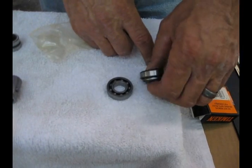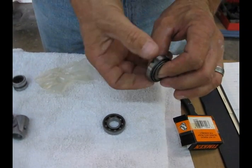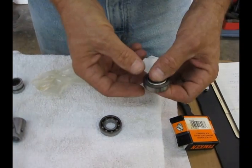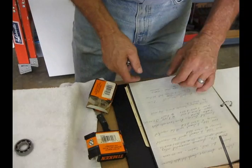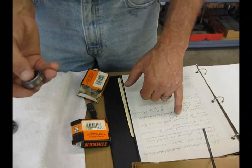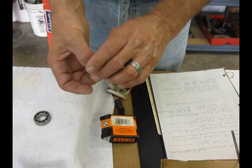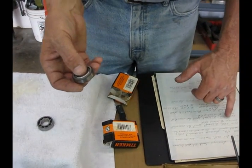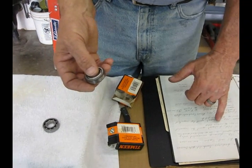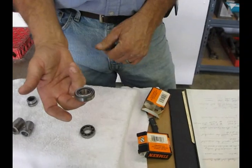Even in an oil spray or oil submersion it'll go higher, about 15,000 RPM. In my notes: 4,600 feet per minute rolling element speed with the suggested bearing, and that's 15,000 RPM. At 4,000 feet per minute rolling element, that's about 13,000 RPM. I have never had a rolling element problem — once I changed to that bearing, that ended everything.